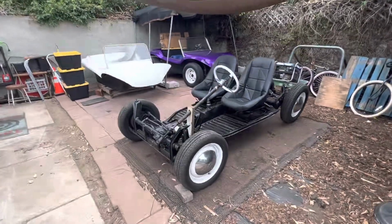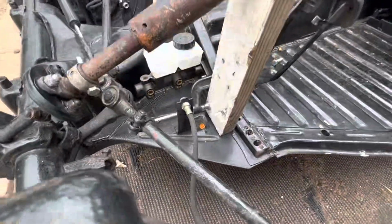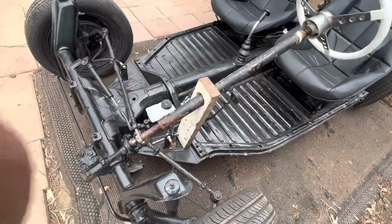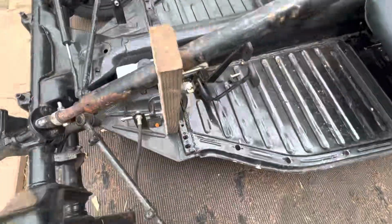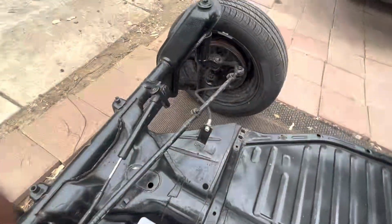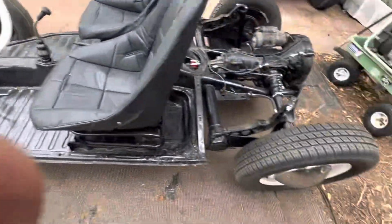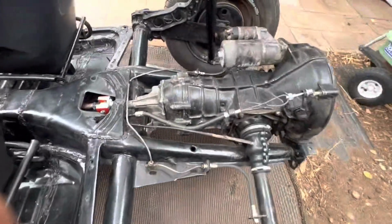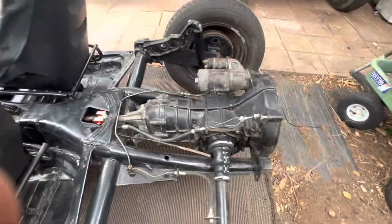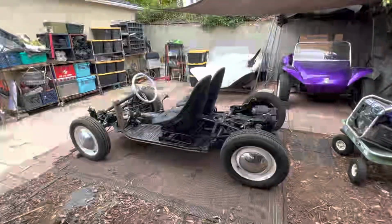All right, back in the shop. Let's see what we got finished off today. We got pedal assembly in, including master cylinder. We got steering mechanism in, still needs to be restored. Brake pedal is in. We have a clutch. We're waiting on brake lines and brake parts, so we can go ahead and overhaul all the brakes. Out back, we've got clutch cable done, shift linkage done, shocks are on, new axle boots, and we're getting ready to roll.